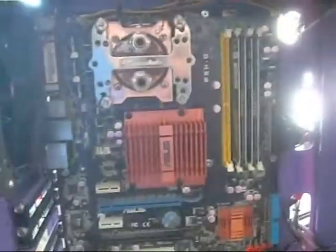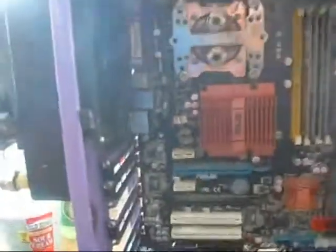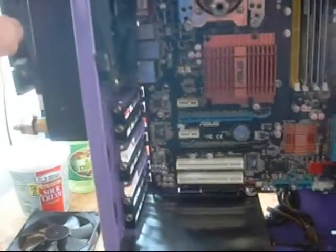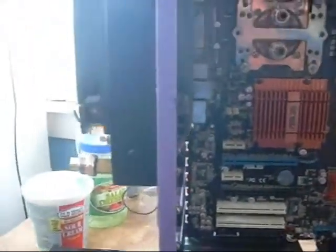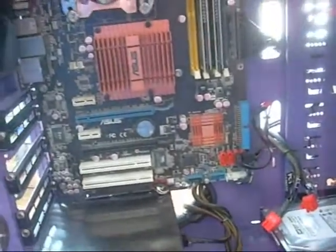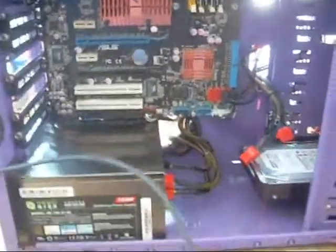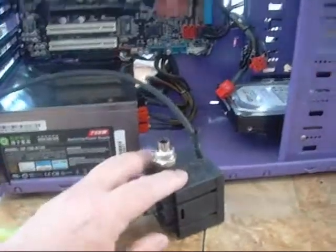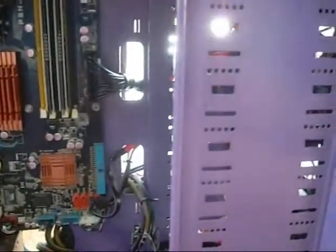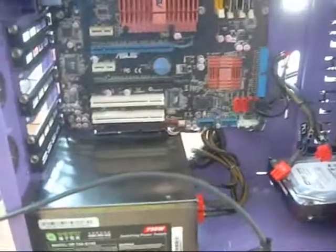Okay, we have the motherboard mounted back in with the water block in place. Got the radiator mounted. Got to do a push-pull configuration on the radiator, remove as much air through it as possible, as well as mounting it outside the case just to make more room in here. With all the hoses and stuff, it's going to get pretty jumbled. But we still got a lot more to do. I have to figure out where I'm mounting the pump. I need to make a custom bracket to mount our reservoir in, and then do all the plumbing and stuff on it, put everything back together.